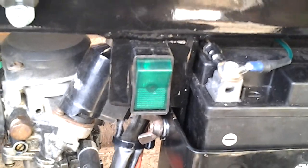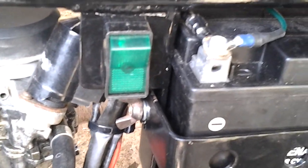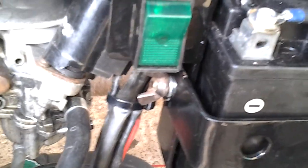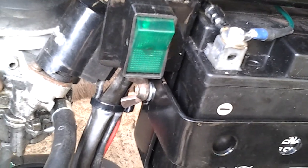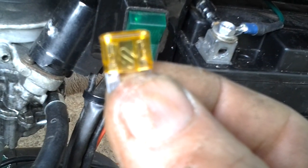The other thing is this power switch has got a light inside it and I wasn't quite sure how the connections on the back were wired. One's got to be an earth, one's got to be the positive in, and one's got to be the feed out to the circuits. It popped the fuse because I had them back to front.